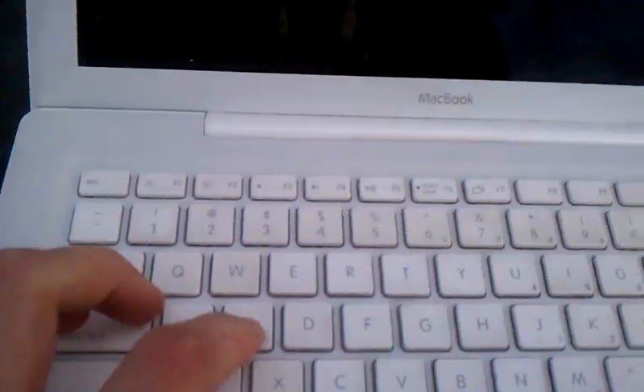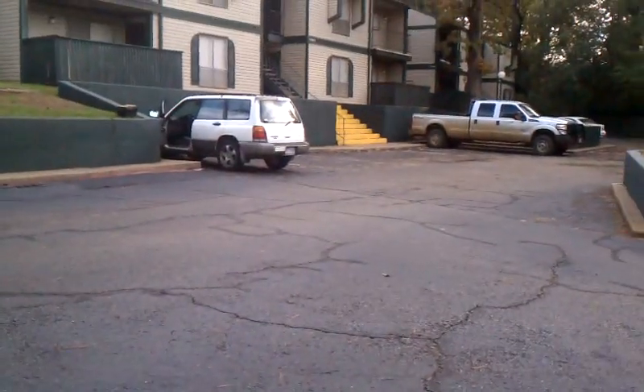The way I have it programmed right now, all you have to do is type an S into the window. It'll take into account whether the car is already running, and whether it's in gear or not. We don't want to start it unless it's in neutral, obviously. So we'll go ahead and do that — I'll just press S on the keyboard and you'll see the car start.